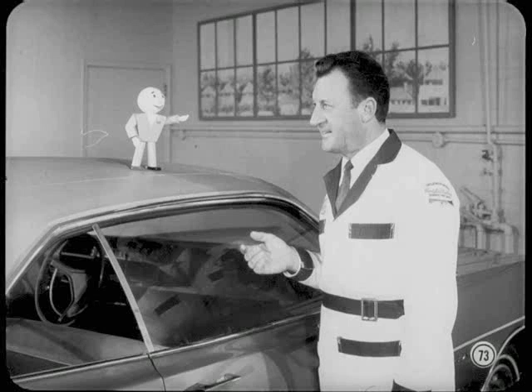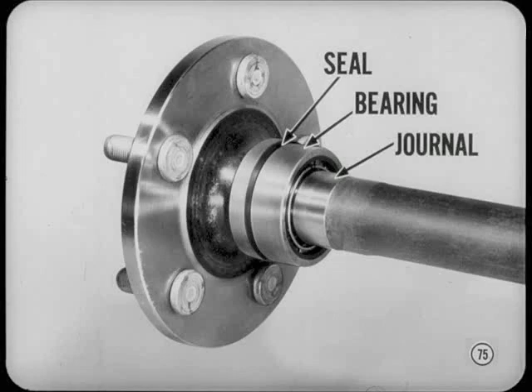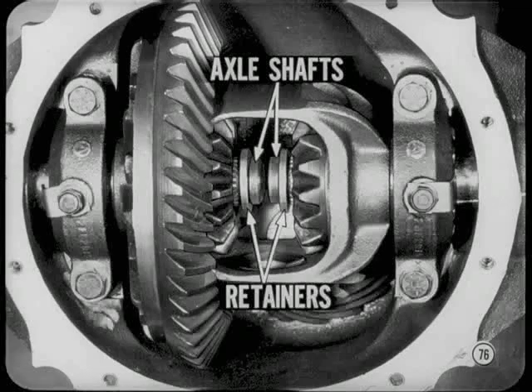There's a new eight-and-a-quarter-inch axle. The new axle is similar in general design to our present seven-and-a-quarter-inch unit, but unlike the smaller axle it has threaded adjusters instead of shims for differential side-bearing adjustment. Axle shaft bearings are the straight roller type without a conventional inner race. The seal and bearing rollers ride directly on a journal surface ground on the axle shaft. The shaft can be pulled out of the bearing without removing the bearing assembly. The axle shafts are kept in place by C-shaped retainers in ring grooves on the inner ends of the shafts, locked in by the side gears when the differential pinion shaft is installed.